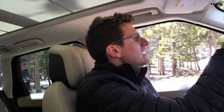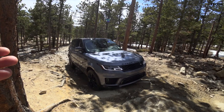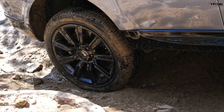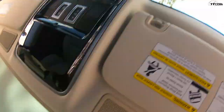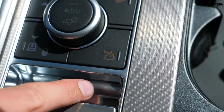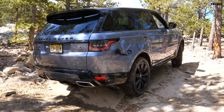At the steps section the Range Rover gets a warning recommending low range, but engaging low range would kick it out of EV mode so we stay in high range. After about 20 feet it gave up and turned on the engine. The display then read 'select low range — transmission overheating.' So it's into low range. Interestingly, you can overheat the transmission even in EV mode because low range multiplies the torque significantly.